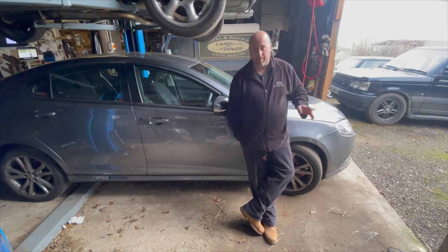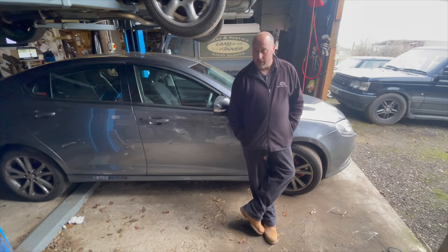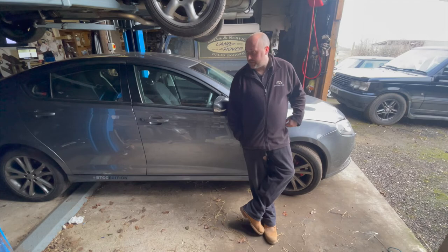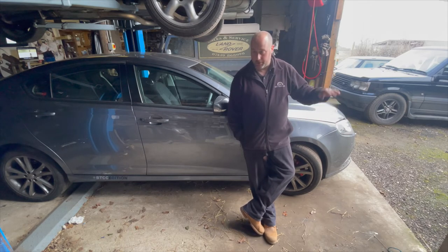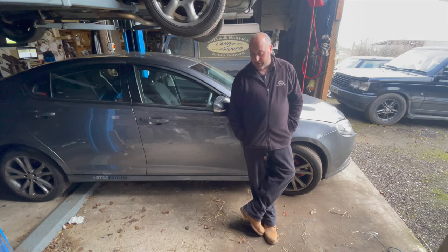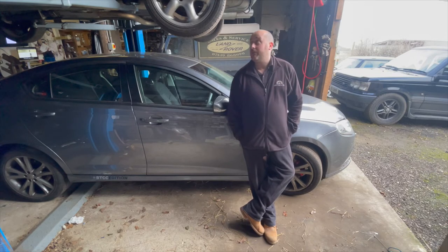So it's either going to be a completely blown apart clutch, which is possible, but I would at least think you'd hear a noise or at least some kind of resistance. You might feel something, but there's nothing. You can just put this in all the gears, no issue at all. So it's either the clutch, the gearbox is blown, or a shaft has snapped, but I can't see anything hanging down. Obviously, I've not been able to get it on the ramp yet.